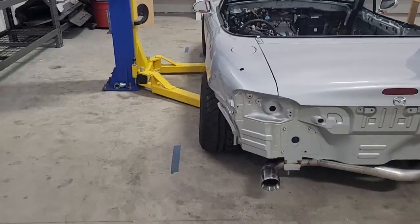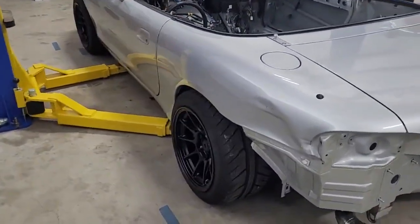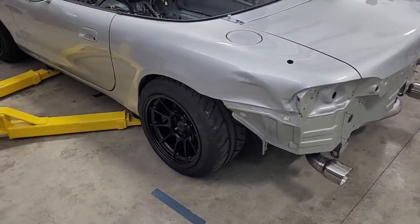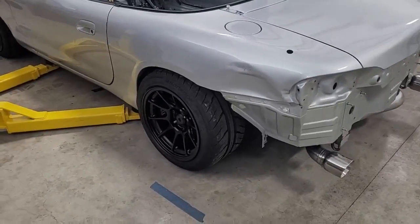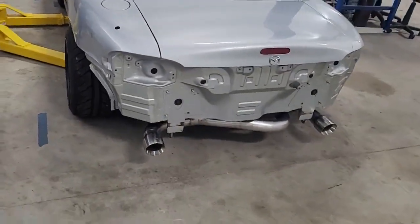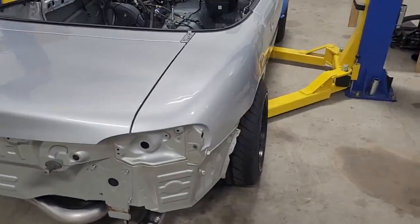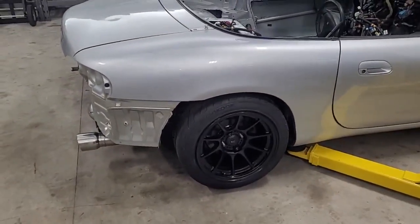Camber was also a limiting factor. You can see it's all jacked up now because I put the adjusters in the middle, but once this is done I can actually add or remove camber properly. Before, we could never get our camber perfect - it was close to zero but when it launched it would go slightly negative. Now I'll be able to set it a little positive so when I launch it'll go square. For the rear suspension, I want to stiffen the back of the car. I've got polyurethane bushings but I think I need better bracing in the rear - I'd have to redo some exhaust to do it, but we may end up going that route.